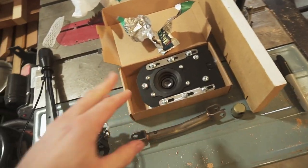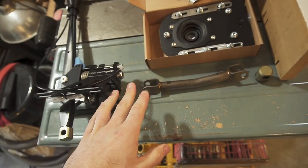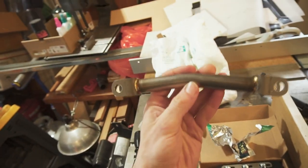The rest of the stuff here is just kind of supporting mods for the shifter. In last week's video, I talked about solid motor and transmission mounts — that's the only thing you won't see in this video. That's important because with a chassis mount shifter, we're removing the entire shift linkage. And since this is self-centering, if your transmission is flopped over to the side because your motor and transmission mounts are soft, you're going to miss a shift. I do have ADA transmission and motor mounts in the car from Garagistic.